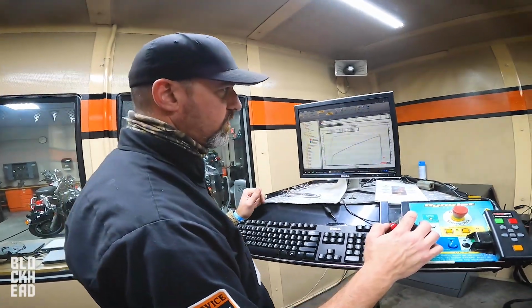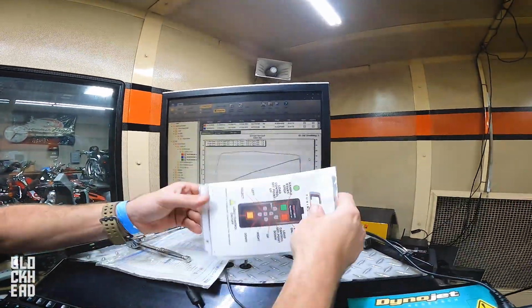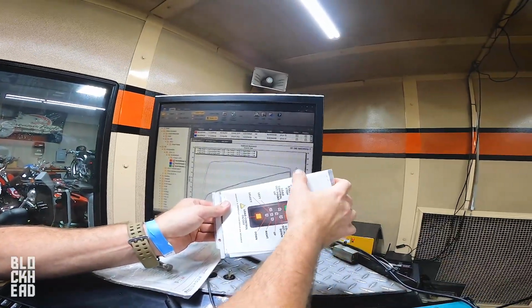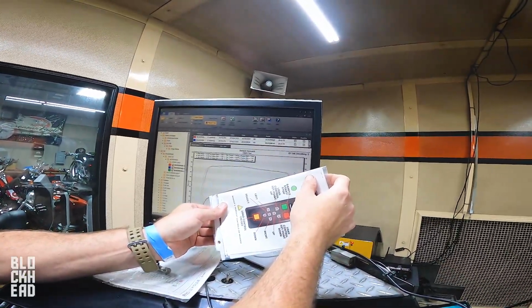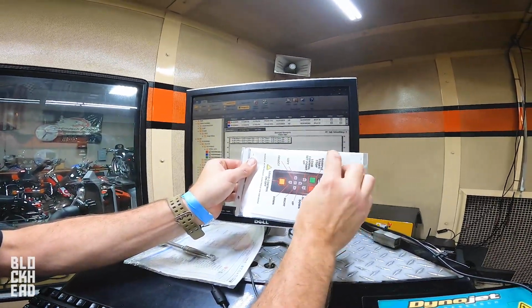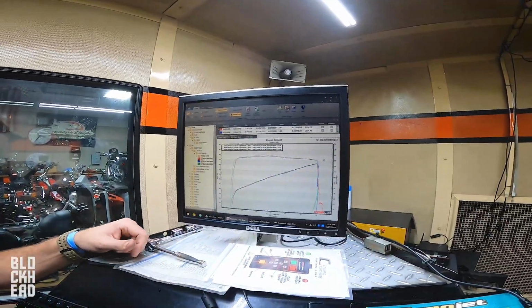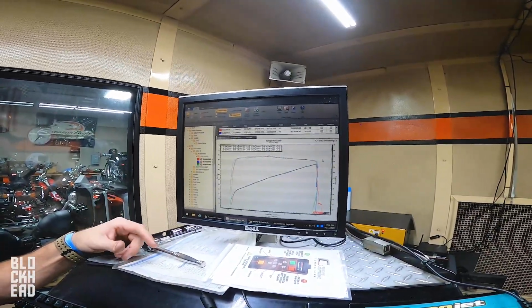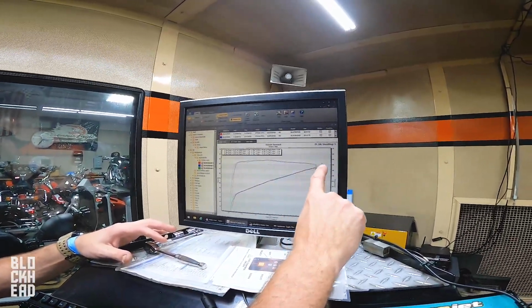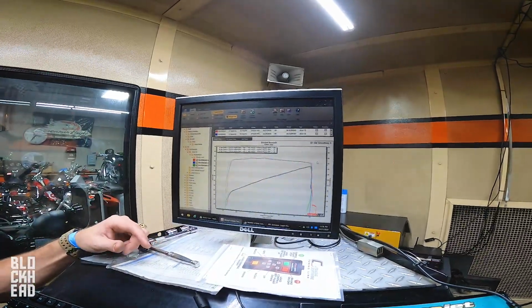Yeah, and you can see that torque's falling off anyway. So you could just draw a line. I mean, you could just literally take something and go, okay, that's probably where it's going to be. You know, it's going to hit 55 horsepower if I just was to match it up with that line. And then trending, this one's kind of trending down, right? So you would watch it and it would cross and be under 55 if you kept continuing to rev it out. You know, mathematically speaking, like if it was only math, you could calculate this and then zing it out to 20,000 RPMs and you could say, oh, I make, you know, 400 horsepower.